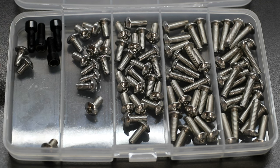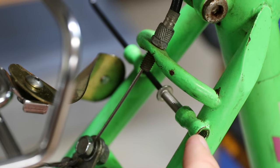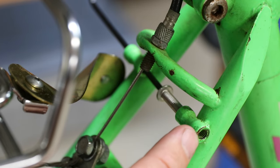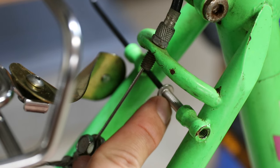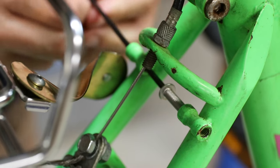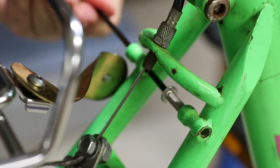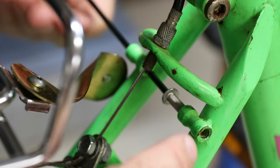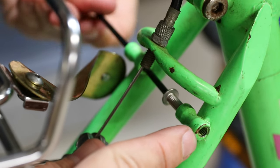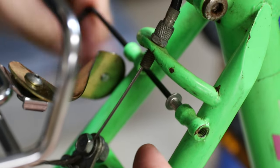I find the short ones I'm using more than the others. What I'm doing now looks a little bit weird, but I was having trouble getting the threads started on this side of this mount. So I found one of those bolts in my kit that were just long enough to reach here. I'm going to try to clean up the threads by running this bolt through this side to hopefully straighten out any kind of damaged thread. I just couldn't quite seem to get that going straight in — the threads feel pretty crusty. Maybe there's some rust in there, but it is moving.